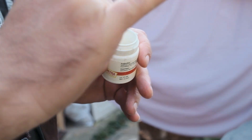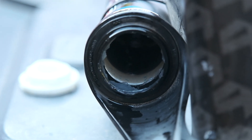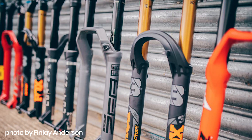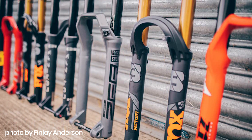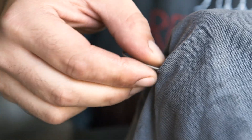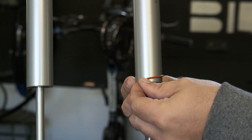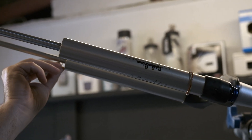After the foam rings are in place, get some quality grease — I recommend suspension butter — and put a small amount around the inner part of the rubber seals. This is an important step because the oily foam and this grease should keep out dust, dirt, and water from the inside of the fork. Now clean the stanchions. Note that these could have some kind of coating, so I do not recommend using any chemicals here — only water, or if really dirty, soapy water. Then clean the metal rings and the red sag indicator ring and place them back on the stanchions. The red ring goes on the leg which has the sag markers on it, usually the right one. The metal rings belong to the lower, but it would be easier to insert it like this.